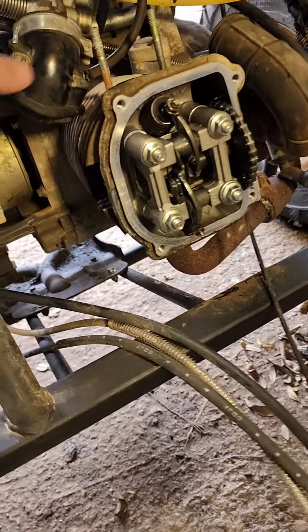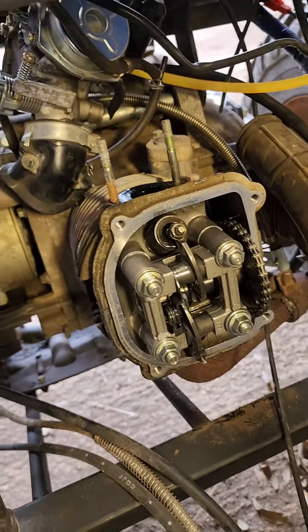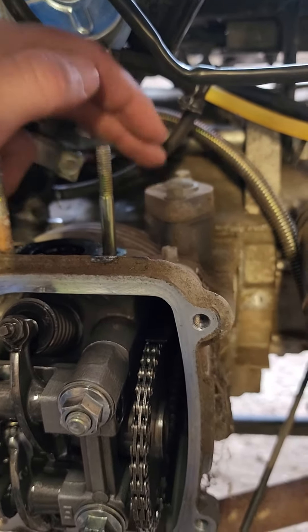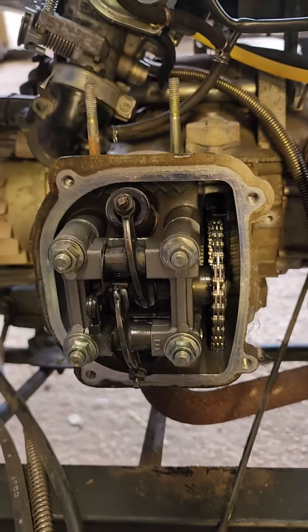We're back. You're going to have to remove your carb intake manifold and get all that out of the way. I pulled that out of the way too to show you your chain tensioner here. You have to remove that first, then you can remove this, then you start taking your bridge out, and that way you can remove your timing chain.